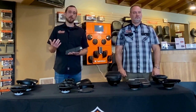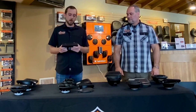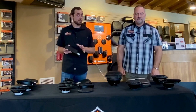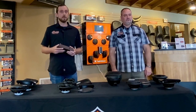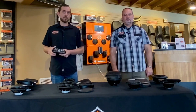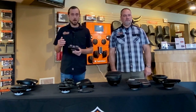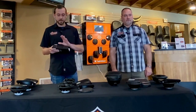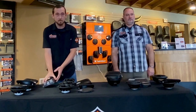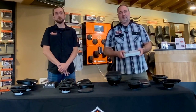With the amplifiers — to piggyback on what we covered — regarding capabilities and how many speakers you can run: the Harley system is a four-channel amplifier, so you can run up to four speakers on one amp. Being a plug-and-play system, you wouldn't have the ability to bridge the speakers without heavy custom wiring, which we traditionally don't recommend. If you want to expand and run more speakers or subwoofers, Harley offers a secondary amp that mounts into the right-hand saddlebag, giving you the ability to run an additional two sets of speakers or a subwoofer. But with the Harley plug-and-play system, you're not necessarily able to bridge out to add more without some heavy wiring — it can be done, it's just not something we traditionally recommend.